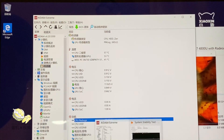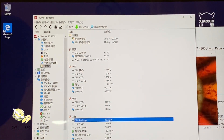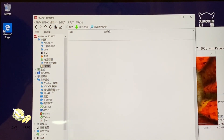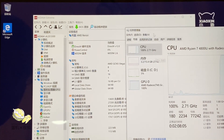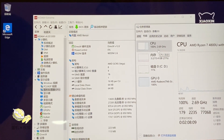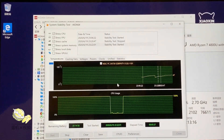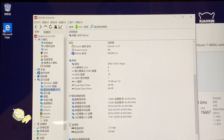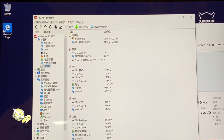It only consumes about 17 to 18 watt-hours of battery, which is pretty good. Adding the CPU into the combined test, power rises to a 25W envelope with the GPU limited to around 800–900 MHz. This is about 10 to 20% lower than the Xiaomi 15-inch GPU clock, and the CPU is clocked slightly higher at 2.7 GHz versus 2.5 GHz on the 15-inch. That GPU difference will make you feel quite different in-game. Note this is all in normal mode without pressing Fn+Q for performance mode.